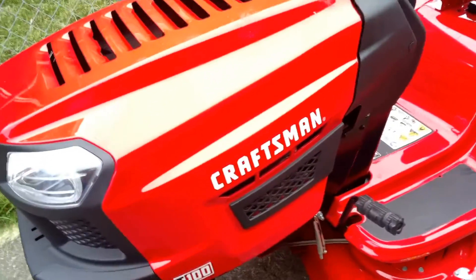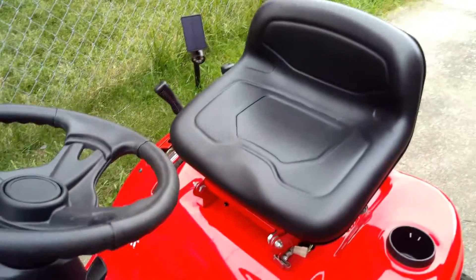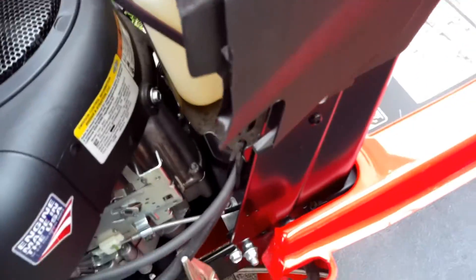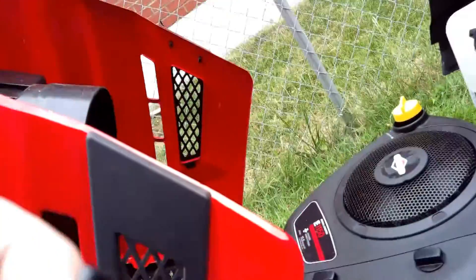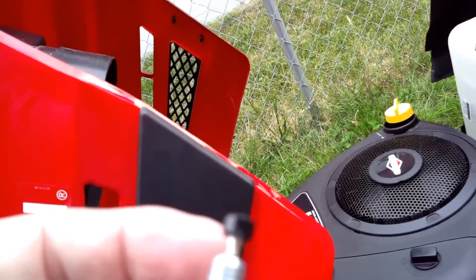Let's get on up and I'll show you what was wrong with it — I'm going to drive up to his house and we'll get it worked on. Okay, here's our mower. It's a Craftsman T-100, basically a brand new mower, looks pretty good. This is the shutoff valve for it. It was on the bottom of the carburetor — here's the carburetor right here. The carburetor bowl is stripped out, and apparently that's probably what it got returned for.